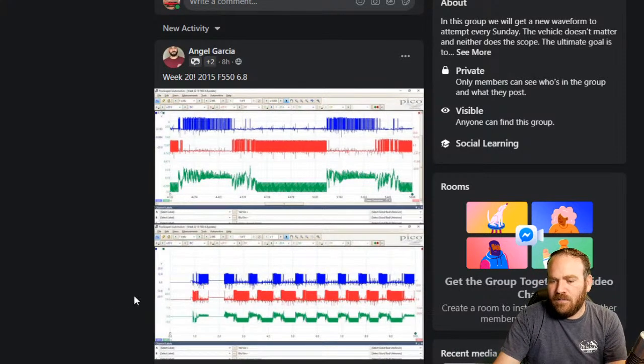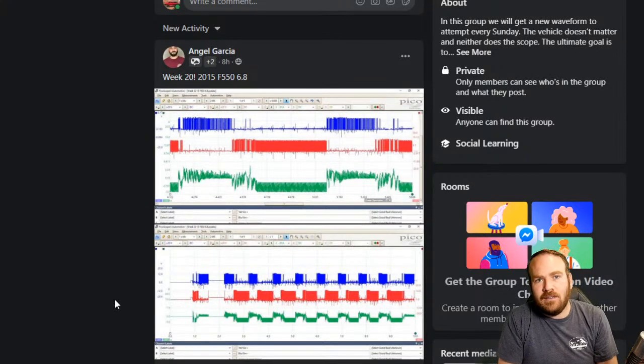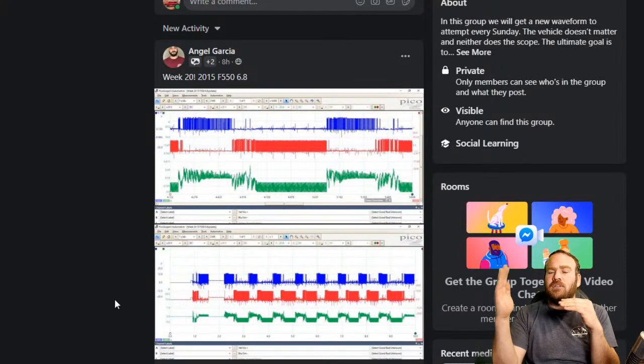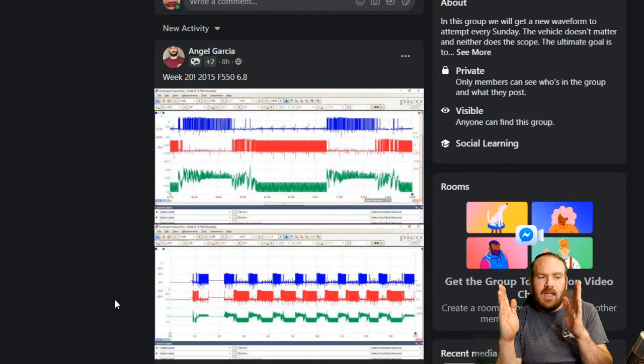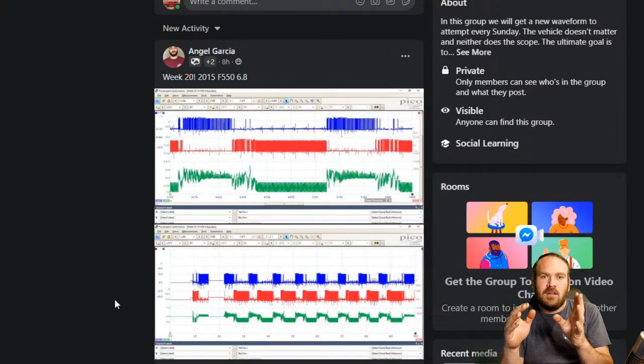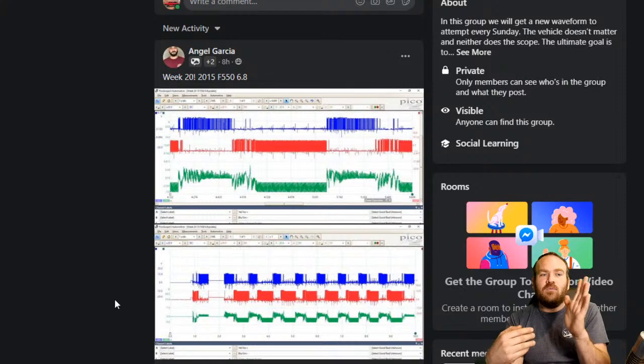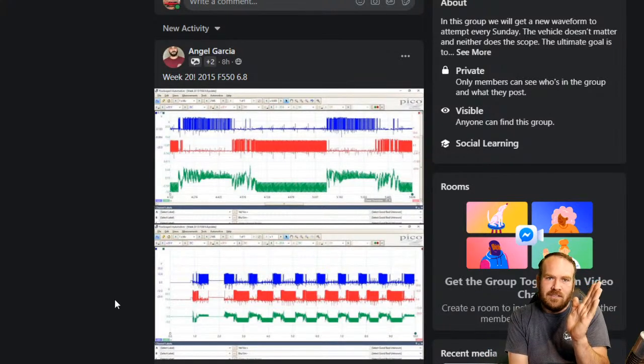Absolutely. If we have any sensor that's 0 to 5 volts, like say a throttle position sensor, and we were reporting all the way from 0 to 5 volts, and that was the normal range of the computer looking at that sensor, well, 0 volts would be when we let off on the throttle, throttle body's closed. Well, if we unplug that sensor, the computer's probably going to read 0 volts as well. So it's going to think that our throttle is closed all the time.